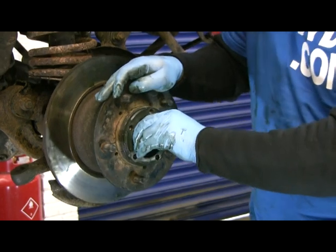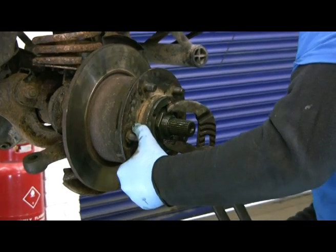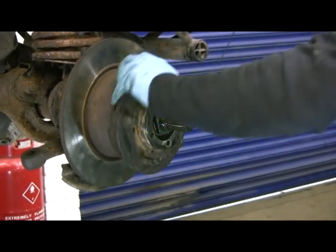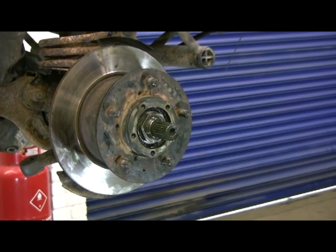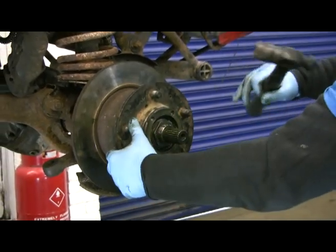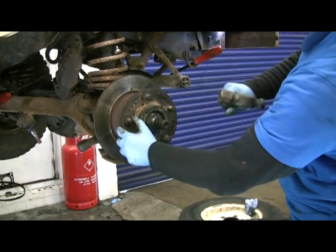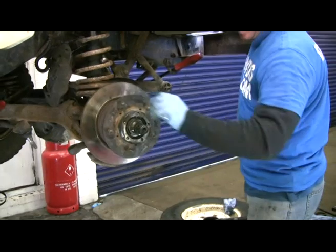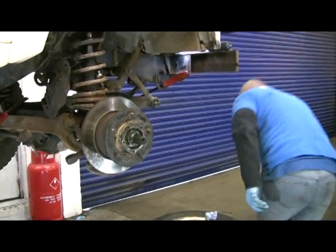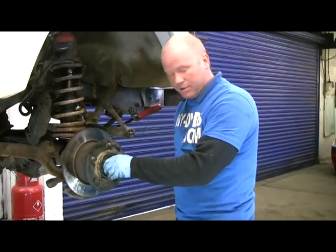Right, okay, that's that. Now what we do is tighten it up with the pump pliers a little bit. Don't wind it right up, just put a nice sensible pressure on it, and then it's only to seat the track properly, just to double check, so that after you put it all back together and put your lock tab on, what we sometimes do if we're not 100% sure is just bang the hub. That has freed up slightly actually, so the few microns play in the track that weren't necessarily taken up are now. So slacken that back off. It's actually just loosened up to finger tight now.